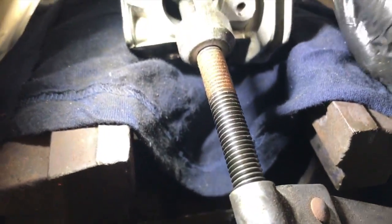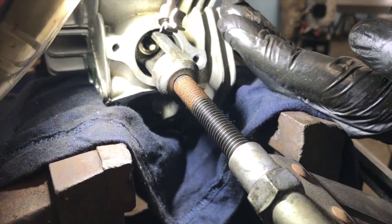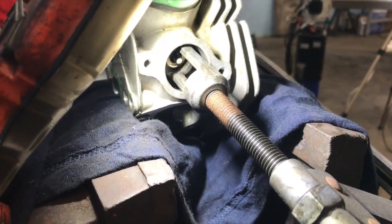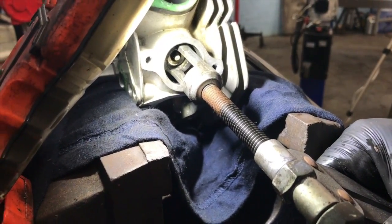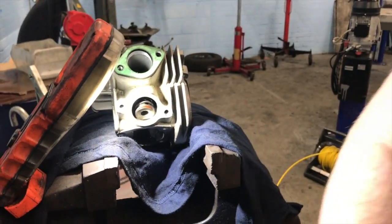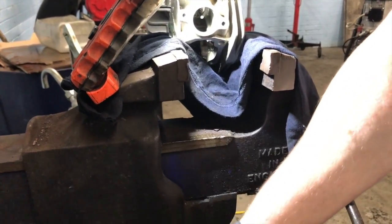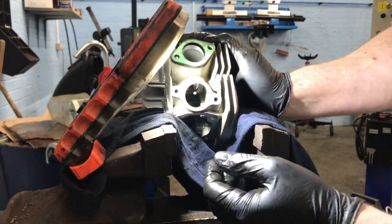See the two collets there, side to side. So we're going to pick them out with a magnet. So that's both of those on the magnet there. Pick them off, don't lose those. Nice new magnet as well. Yeah, I know, stole it off a Snap-on van. So now we release that. It's slowly releasing, and look, the valve spring is giving birth. So the head's going to give birth to this valve spring. So this one did have double valve springs in it. See that, people? You never heard of a head giving birth until now.